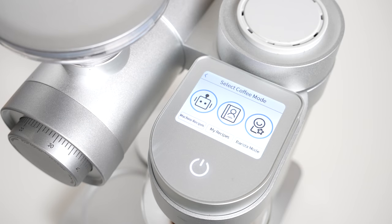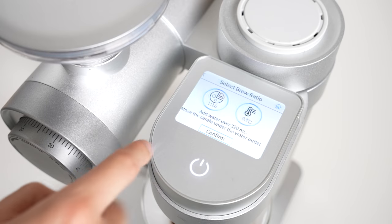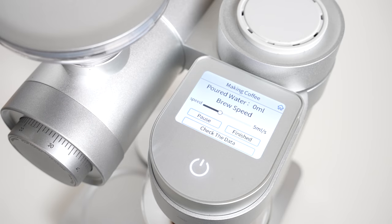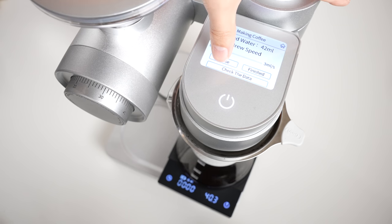Brewing modes are split into several options depending on how involved you want to be. In all of the brewing modes, the screen displays live information including flow rate and total volume poured, as well as a graph that plots them both over time. Barista mode basically allows you to use the machine like a very accurate gooseneck kettle — you can set the water temperature, stop and start the pouring at will, and even adjust the flow rate between pours. I measured the flow rate using my normal brewing scale and was shocked at how perfectly spot on it was: 3 milliliters per second results in 30 milliliters being delivered in 10 seconds. There is a little delay between when you press stop and the rest of the water exiting the system, but the interface appears to be offset so that the number you see on the screen is the number you end up getting in the cup. Pretty impressive.